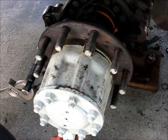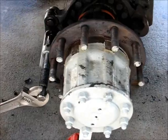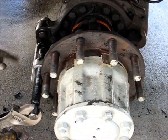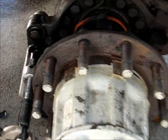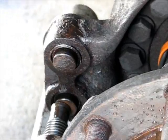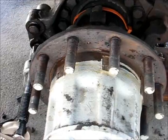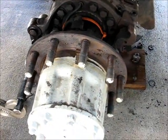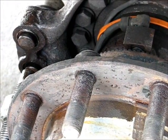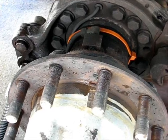Now what are we doing to this? We're pulling out some bushings so the brakes will run smooth. Because in theory, these are supposed to go in and out by your fingers and lubed. When you get jammed up like this, most of the time the guys don't do them when they do the brakes and they get all seized. So you use a lower or upper bushing or ball joint tool and it works wonders. And you can buy these at your local Harbor Freight for peanuts, or your local tool supplier.